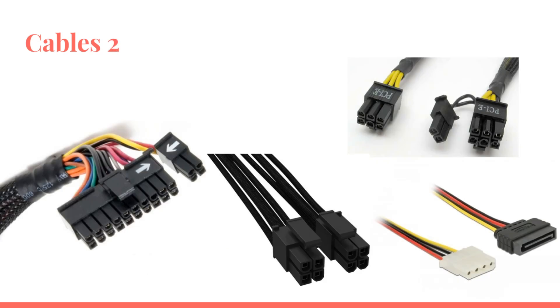Let's take a more realistic look at the cables. On the left we have the 20-plus-four-pin connector — you push them together and insert them into the 24-pin connector. In the middle there's the eight-pin, which is a four-plus-four. The reason they're separated is so you can use the new power supply on both old and new motherboards, as well as some budget boards. To the right we have the four-pin Molex cable, sometimes still used for adding things, and the SATA power cable.